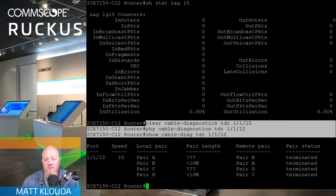If you have the cable that you bought, Andrew, just plug into the console the same way you did the other day, and get into it that way. Because I don't know if we ever turned on Telnet or SSH for you. So use that serial or the USB cable, get in the console, plug into it with that serial program that you used. You'll get into it there, and it'll give you a prompt like this.